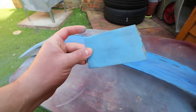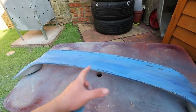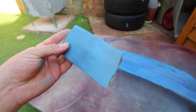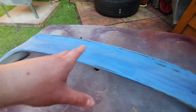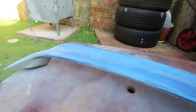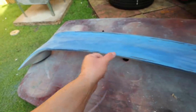I've just gone over the spoiler a couple of times with some 800 grit. The reason I did that is because the tougher sandpaper from the electric sander does leave small scratches. If you were to leave it like that and spray primer over it, you would see those scratches come through. So I went over it with a really fine 800 grit just to take out those deeper scratches so you don't see them when the primer gets put on. I've taken all the primer off and sanded away a lot of the Arden blue, which was the original paint.